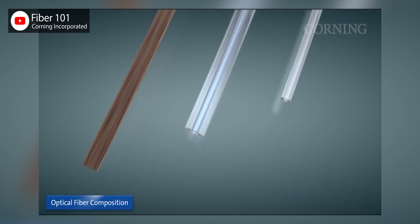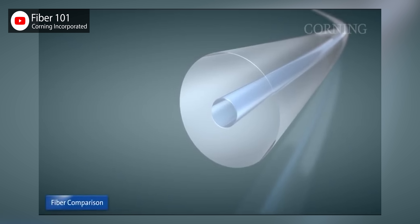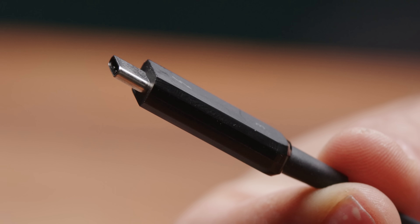It's not one — it's a fiber optic cable. Now most optical cables contain one or two strands of fiber optic filament, but this one has six. Each of them is just one quarter of a millimeter in diameter, with a glass center that is just one eighth of a millimeter, and then a core where the light actually travels that is less than half of that again. Fibers like this are used in many data centers and can transmit 20 gigabits per second. So one pair transmits 40 gigabits per second, another pair receives 40 gigabits per second, and the remaining pair carries lower bandwidth control signals between the two ends. To the devices on either side, it appears as a completely normal Thunderbolt connection — no drivers required.